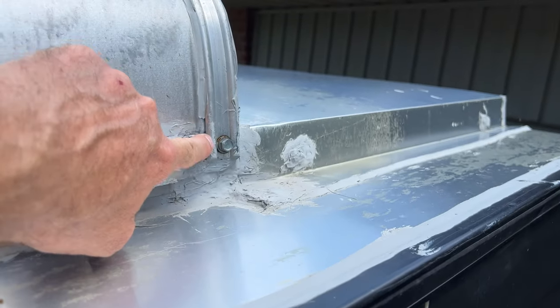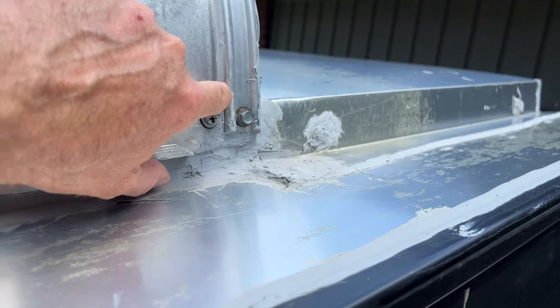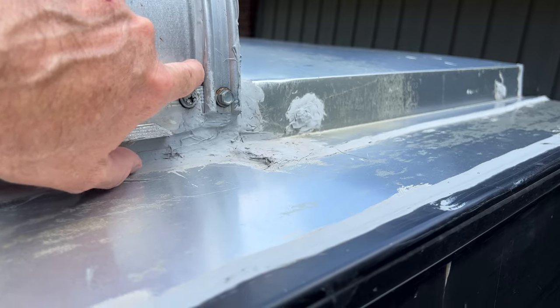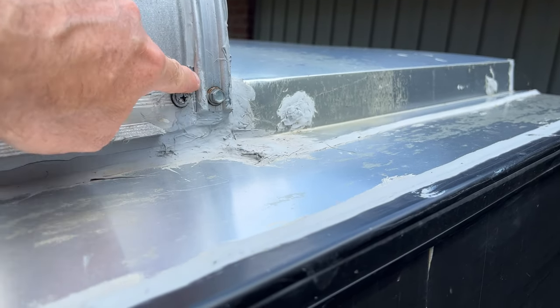You can see what I did is I cleaned off all the loose sealant. That's the first step — really make sure this is a nice clean piece of metal. Sometimes I'll take a scrubby and just scrub it. I try not to use acetone because acetone reacts with this sealant and makes it weak.